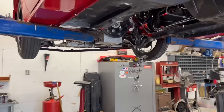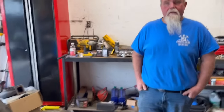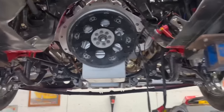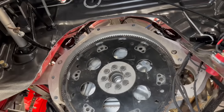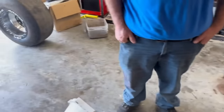The other thing we didn't know was a problem: this billet plate. Donald tried for three hours one night to get the converter to seat back into the transmission and it wouldn't go. It was almost flush — we thought it wasn't going back far enough. The reason is the lockup converter is taller, so you have to have a spacer plate. TKM custom does those. If you don't have that spacer, it's a problem.